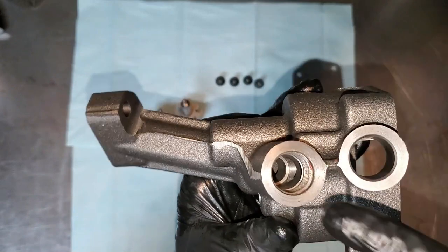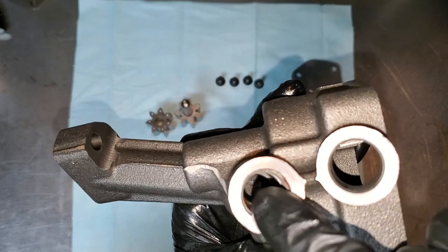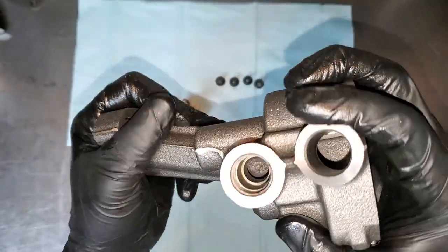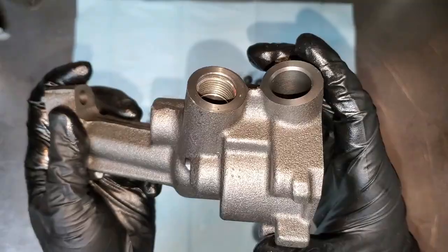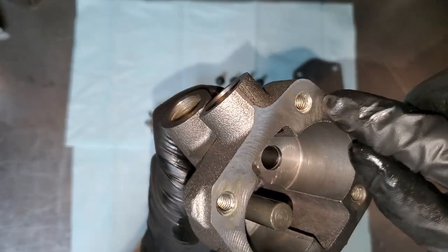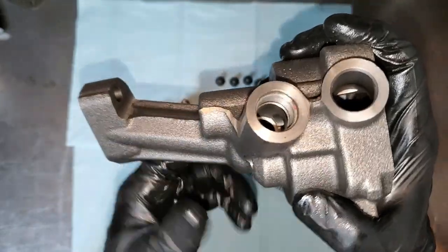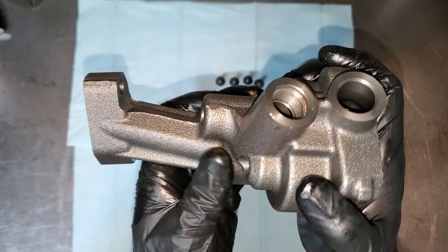If you're not comfortable with an 80-pound pump, you can get a 60-pound version. They also lap where the ball sits down in the bore, so you get a better, more uniform fit. They blueprint all the dimensions — including the spring — to keep record. When you reassemble, make sure everything is totally clean. These four bolts get Loctite, and also put Loctite on the lock nut for the spring so it doesn't back out.